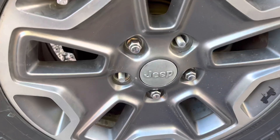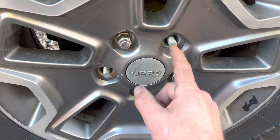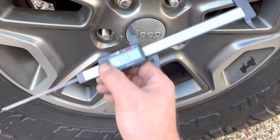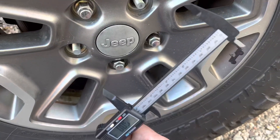When you have an odd number such as a five bolt pattern or a three wheel bolt pattern, you're not going to measure from the middle to the middle. What you're going to do — the correct way to do it — is measure from the middle of one stud to the outside of another stud. On a five lug pattern it's a little bit different the way you measure.